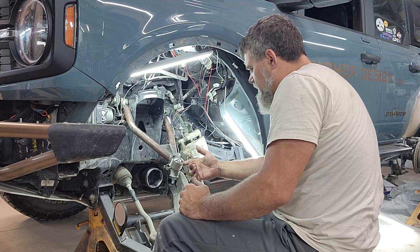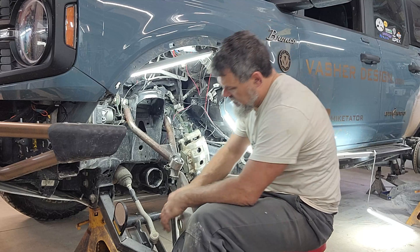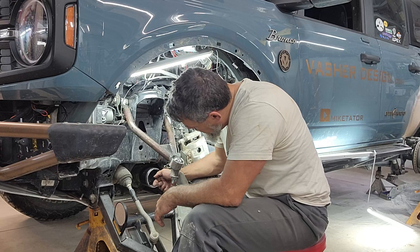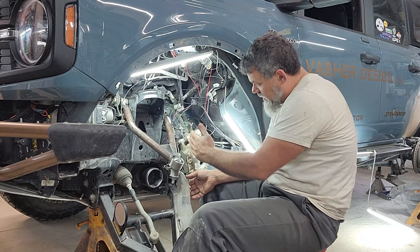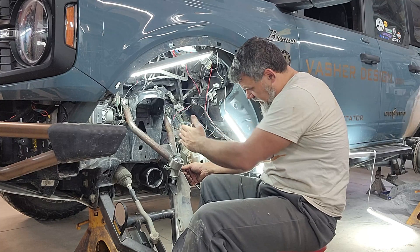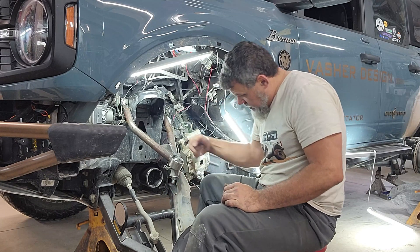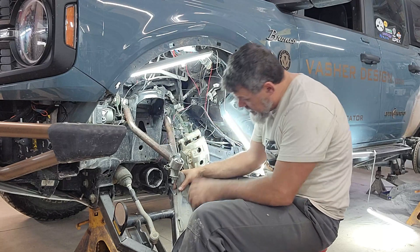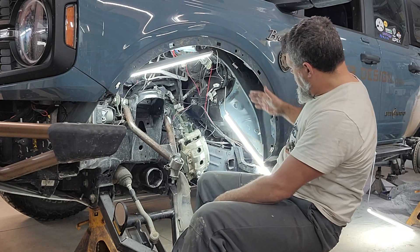With a larger uniball up top we can definitely increase the up-travel. The down travel is pretty much limited where it's at because the CV in here is only good for 37 degrees. We're maxed out with a slight compound angle because the axle short shaft coming out of the CV isn't coming straight out — it's going forward slightly — and even more so on this system because we've actually moved the front wheels forward slightly to help out with clearances.